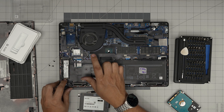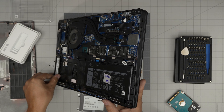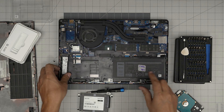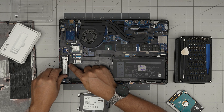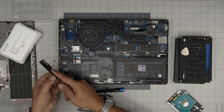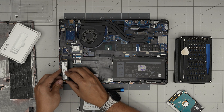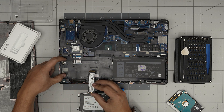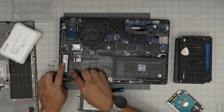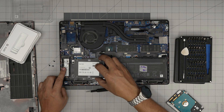You can put up to a four terabyte NVMe drive in here, which is much faster than the SATA connector. Get about 0.5 millimeter foamy double-sided tape, cut about half a centimeter worth, place it right underneath the M.2 slot area, then insert the drive at 45 degrees, bring it down, and let the tape hold it in place from the bottom so it won't come up. That works just fine.